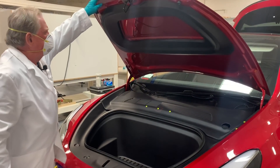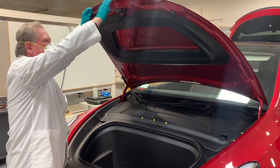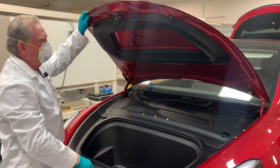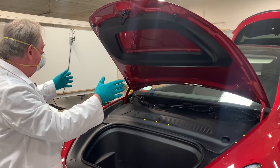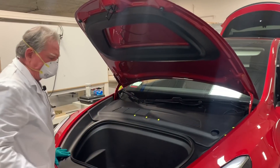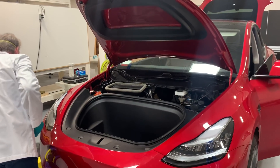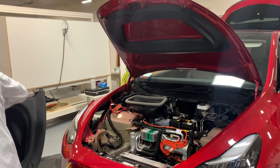These points here should not be touching before it gets to the bulb seal, but that is precisely what is happening. That could give us a bow in the hood — and if there's a bow back here, that's going to bend things up, which means when you're trying to push it down you won't connect properly with the latch. So we have a bit of an issue with closure.